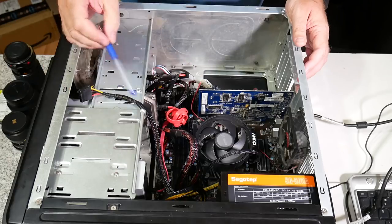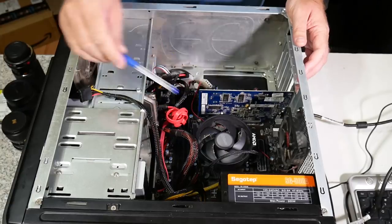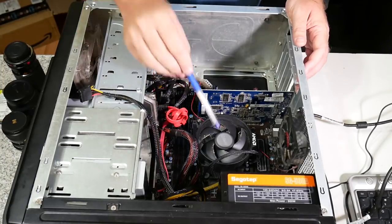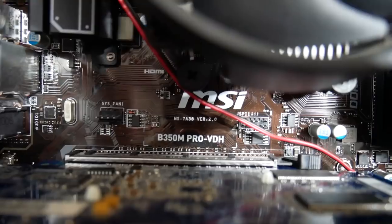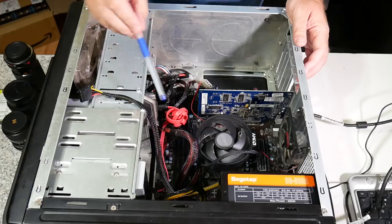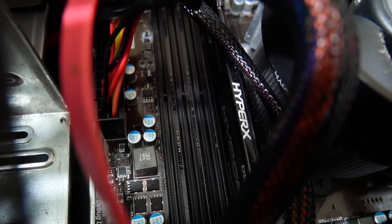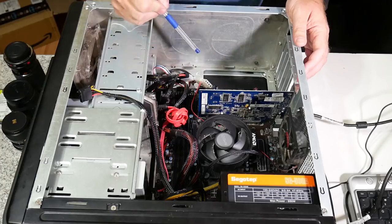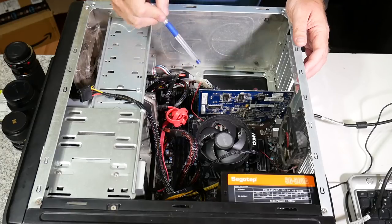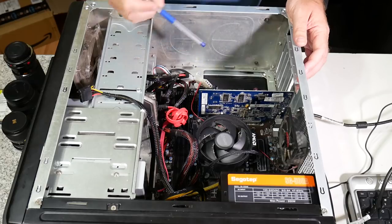Let's look at the PC as it stands. We've got a fairly good power supply — it's a 500 watt unit and it's also got all the right connectors on it that we need, so we'll leave that alone. Here we've got an AMD Ryzen 5 1600 CPU, so we're going to leave that alone. And we're also going to leave alone the motherboard that comes with it. However, there are four gigs of memory here and yet we've got four slots, so at least we're going to upgrade that to 16 gigs. 32 would have been nice, but our budget means we're going to stay at 16 gigabytes. And we've also got a fairly old and generic video card here, so we're going to upgrade that.